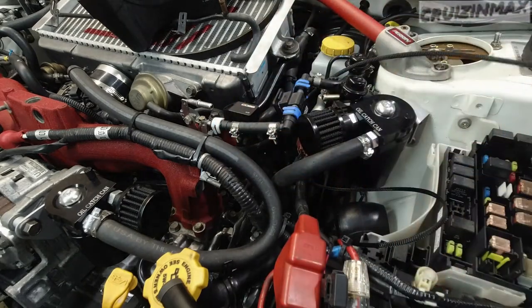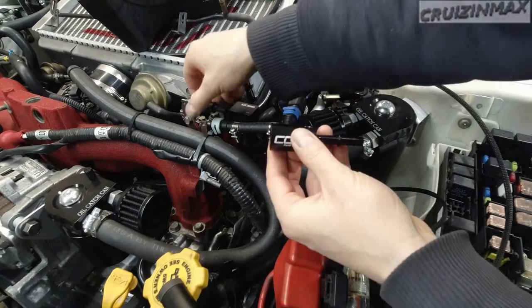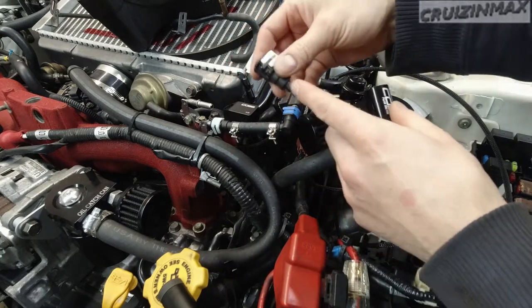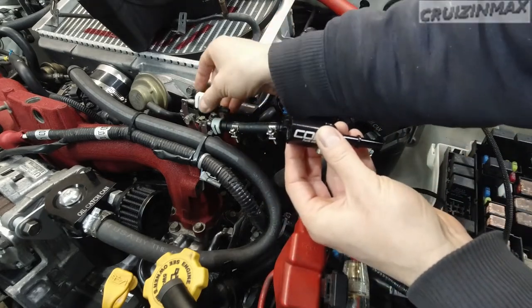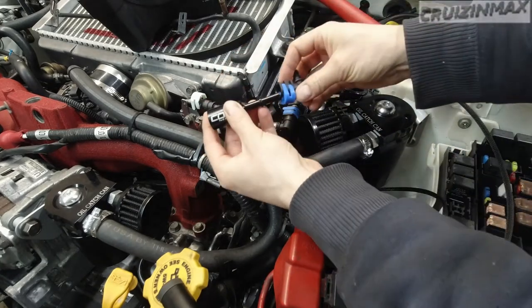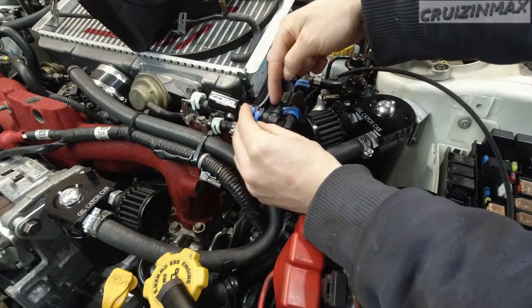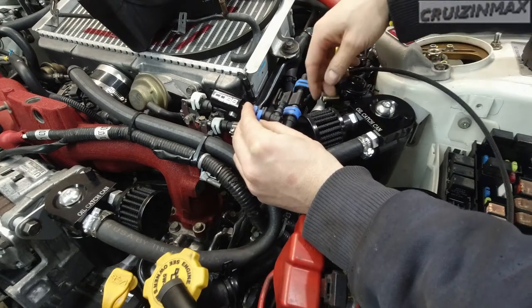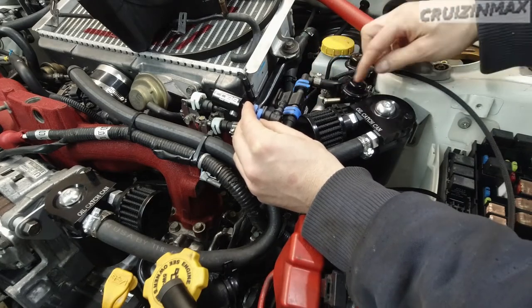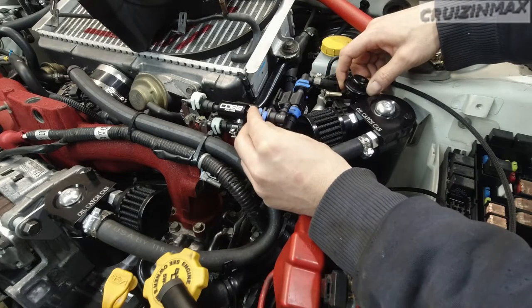When the hood closes up, it seals around the intercooler, so that may become a problem right about here. So what I'm thinking, first the white connector here, and then I can hook up this, which is both a barbed and Bundy connector, so hoses and these guys can connect to it. So this, then the adapter, then the 90 degree connector here, and a hose from here to here. And then I'm just gonna probably bend the bracket up so I can mount this damper onto the bracket. And this should be good, I hope.